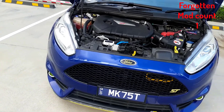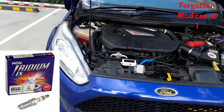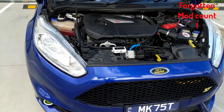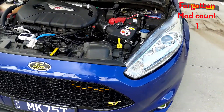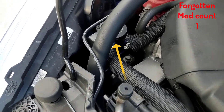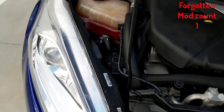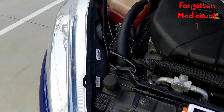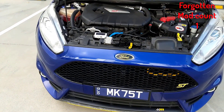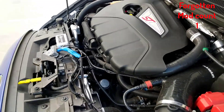Other cooling and housekeeping mods: got NGK Iridium one-step cooler spark plugs gapped to 0.026 inches, or 0.66 millimetres — about the Stage 3 spec gapping that's recommended. Got a Mishimoto oil catch can, which catches all the oil blow-by. There's a fair bit of crud that thing catches — it's definitely worth doing. I had that on the car pretty early on. You don't want that stuff going back into the engine.